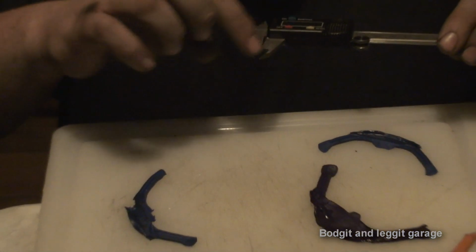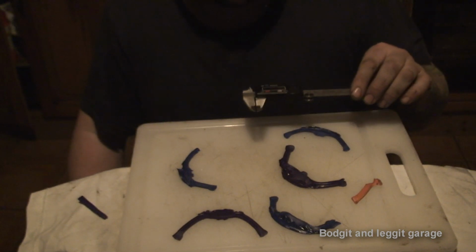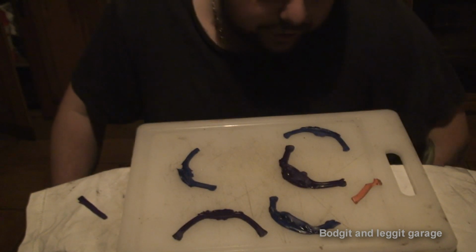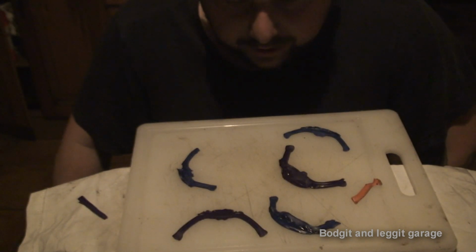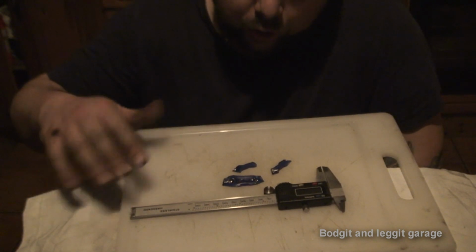And when I'm pushing the plasticine through, I'm seeing if it's basically... That last one was kind of hard to get through. So I know it's maybe even a little bit more, maybe 1.4 mil. So I'm going to check all these. We'll turn the camera back on and then we'll go from there. Now, I've done them all and it's looking quite good.